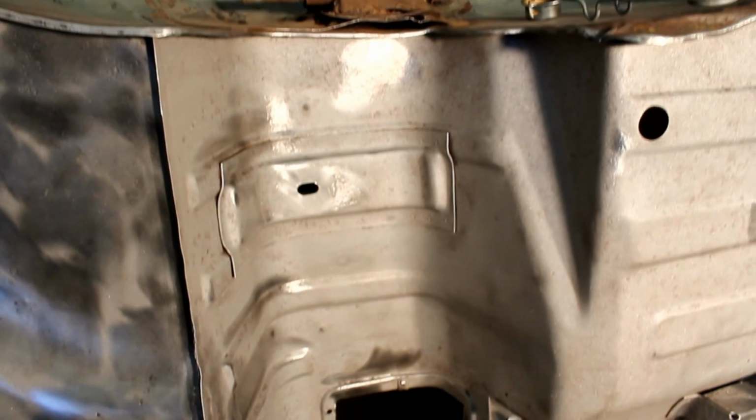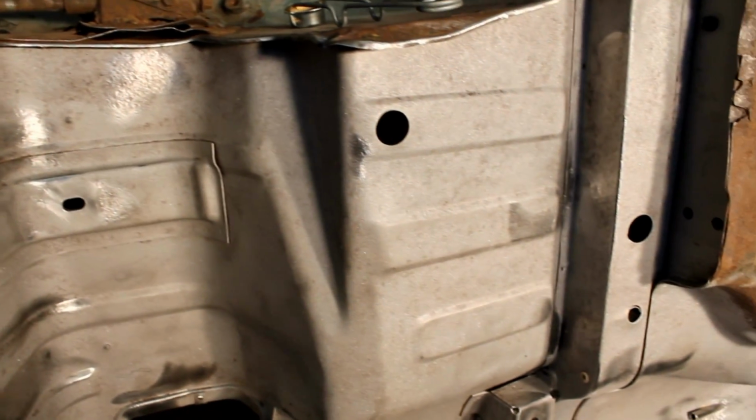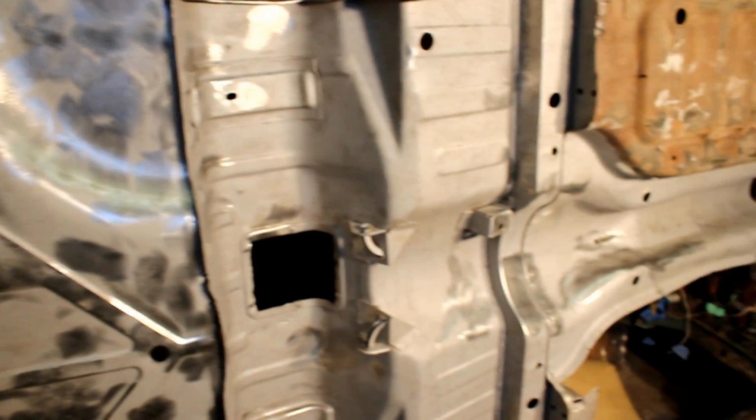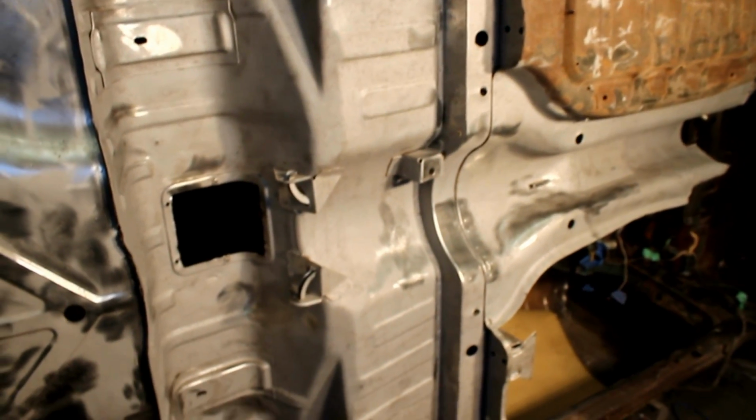With the amount of dust produced from sandblasting, it's very hard to see if you've missed any small areas of rust. So once we'd removed most of the stuff, we came back with a wire wheel to tidy up the last few areas before primer.